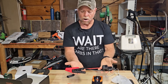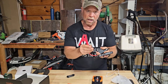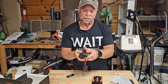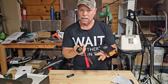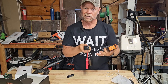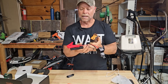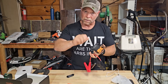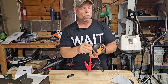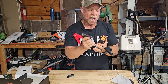What we have here are our alligator clips. This is going to connect to your negative terminal and your positive terminal, and this plugs into the positive and negative side of your jump pack. We're going to get a flashing LED indicator letting you know that we are connected and ready to connect to the battery. When we connect to the battery, we'll get a steady green light meaning it's okay to turn the engine over, or a red beeping light indicating that we have crossed our wires.